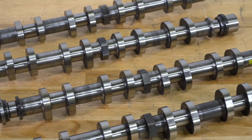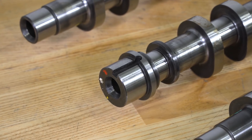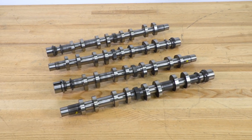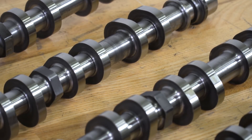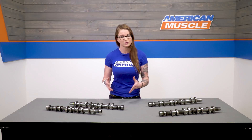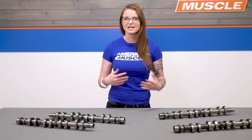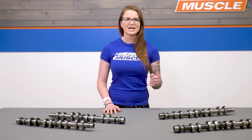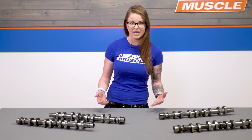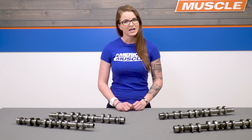One of the first things to say about these cams is that they have a huge power band. You're looking at an RPM range of 2000 to 6400, which means these things make the most power right in that range. That's great news for the types of builds these cams are for — superchargers and nitrous. And in those upper RPMs where the cams aren't as efficient, you have your power adders making that big power for you. The fact that these give you gains in the lower RPMs too means that you don't have to rev the car to the moon and back to have the benefits of cams.